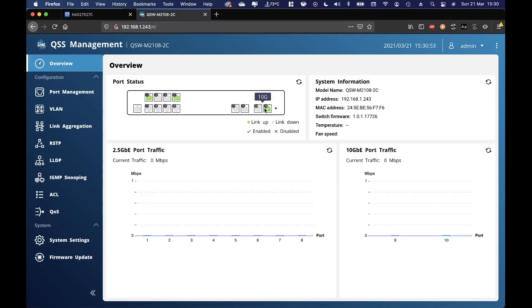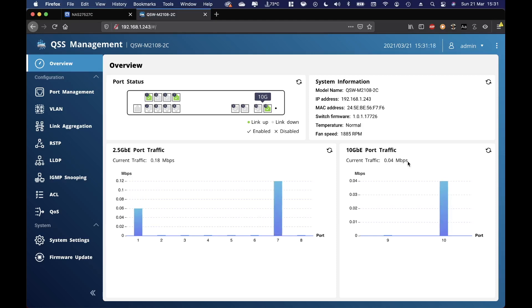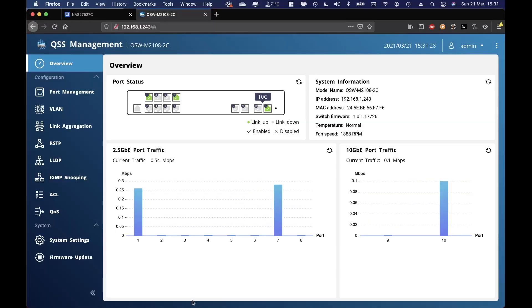First, let's do a test with a one gigabit machine — I have my Mac mini here with iPerf installed. We're getting one gigabit connectivity, showing 900-something then up to 1000 megabits then 600-something, then it drops to zero as the connection ends. I just want to establish a baseline here — this is a gigabit connectivity result with no surprises, something we've had for quite some time.